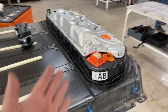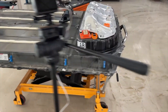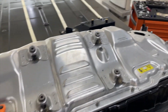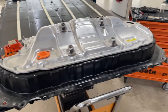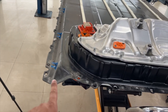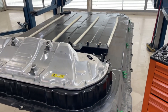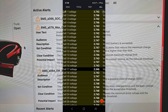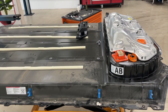We will now proceed to document the complete disassembly process - it will be available at EVC Academy. We will make pictures of every step because this is a really complex thing to do. You need to disassemble all parts inside the penthouse, then unglue all around the back, and then you are able to remove the upper cover. In this picture I'm now showing you a reading from 15 days ago, showing brick 17 discharged with almost 400-500 millivolts of delta.